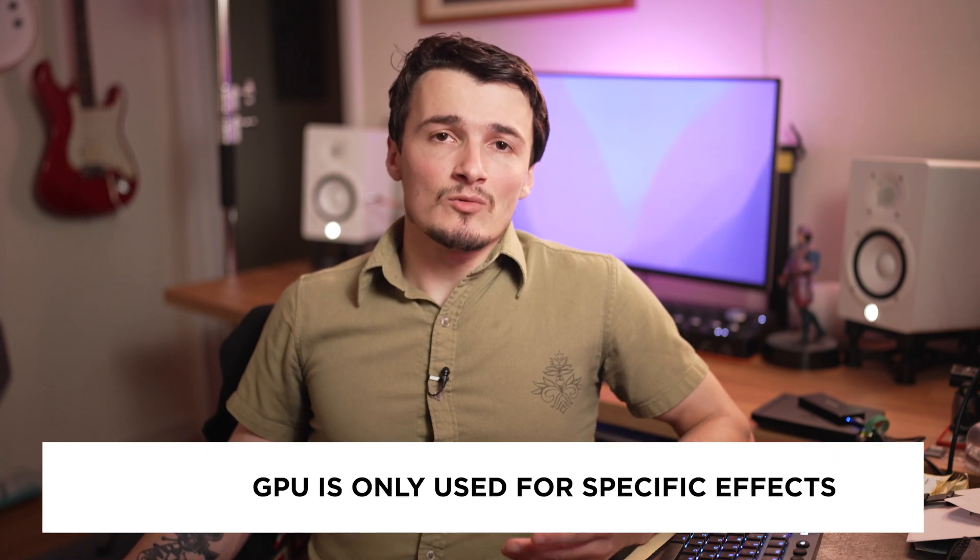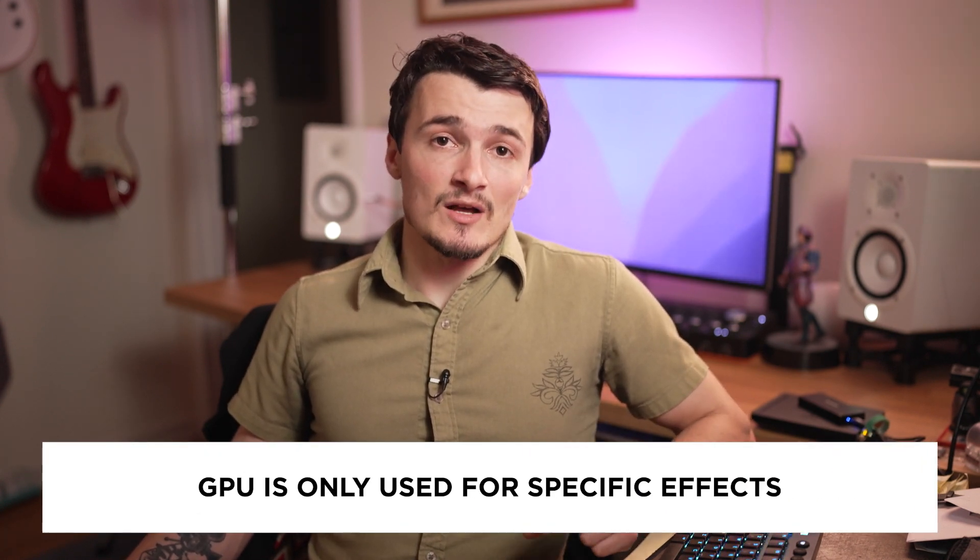While editing this video I realized I needed to clarify a few things. When I say you don't need a GPU for video editing, what I mean is you don't need a high-end GPU. Something like an RTX 3060, 2070, 2060, or even a 1080 is going to be perfectly fine, because GPU in video editing is only utilized for very specific GPU-accelerated effects — not all effects. It's also dependent on the program. DaVinci Resolve tends to rely a little bit more on the GPU than Adobe Premiere. The bulk of your editing is going to be CPU-bound. Do not dump a ton of money on an expensive GPU — get something mid-tier, it's going to be fine.